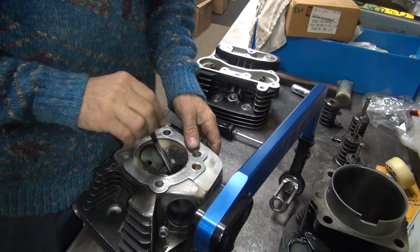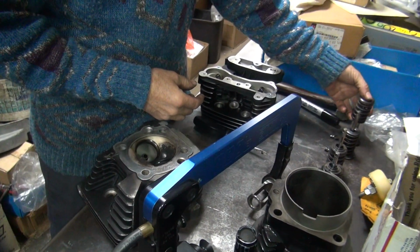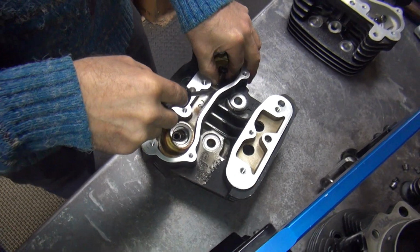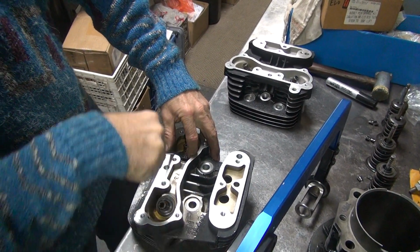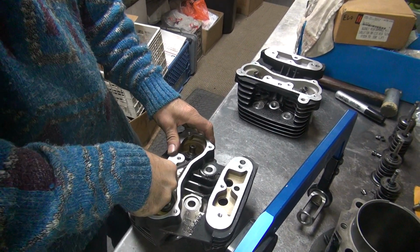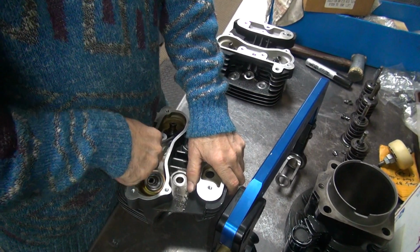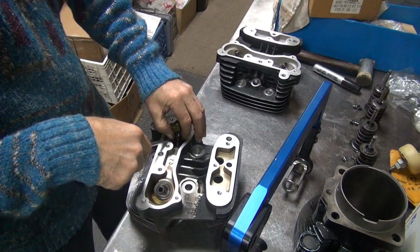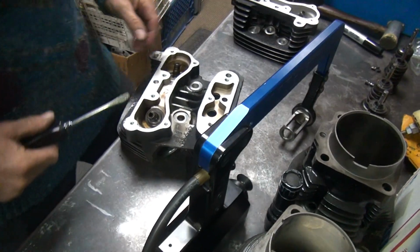A lot of carbon buildup. Good. Loose, but not very loose. A lot of heat buildup though. Is that old heat or new heat? It doesn't want to come off. Appears to be tight, till you get to the top, then it's loose. So intake goes on that one.